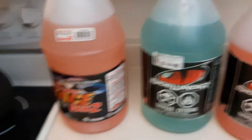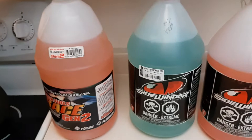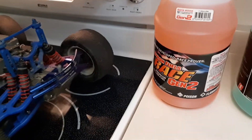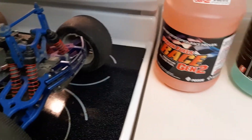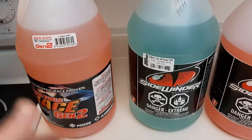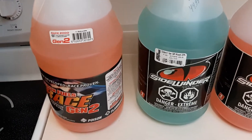With fuels like this, if you're just going to be ripping around, it doesn't really matter — you don't really want any more than 12% oil content with RC cars. I noticed if you get like 16% or 18% oil, or something like Traxxas fuel, it just doesn't perform good. The tuning window is smaller — no fun at all. So stick with something like 20% nitro, no more than 12% oil, same with a 30% or a little less oil if you really want — up to you. Let me know what you guys run down in the comments below, I'd like to hear.